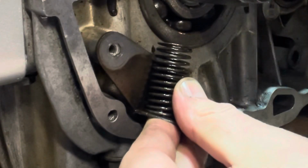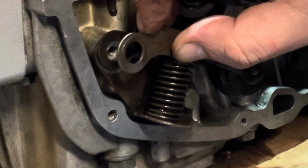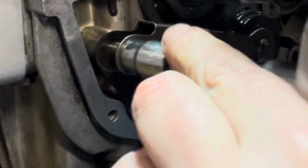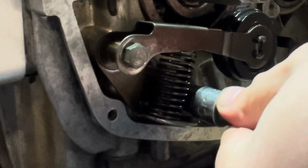This wheel is gonna come over. I'm gonna set it down on there like that, and we're gonna align against that. Take our pin and feed this right into here. So this is this bottom tensioner on that big drive chain on this side. Grab the ratchet. Again, remember you're going into aluminum, so you don't wanna go crazy with stuff. Let's cinch that up and we'll come down here and cinch this one up. Just like that.